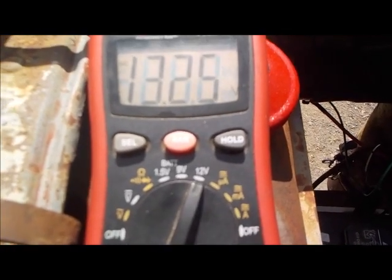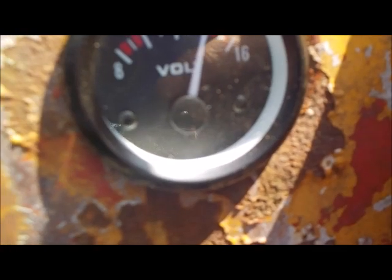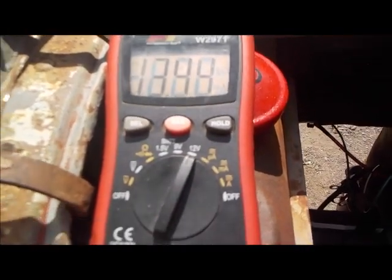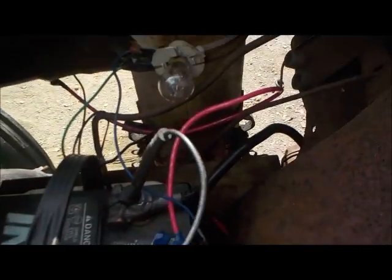She's climbing, she's got a low idle. Meter's reading almost 14. Low idle — back it up a little bit. This is a very cheap meter, it's a Harbor Freight job, but I trust the voltmeter. Holding at 14 — lights out, everything is good.